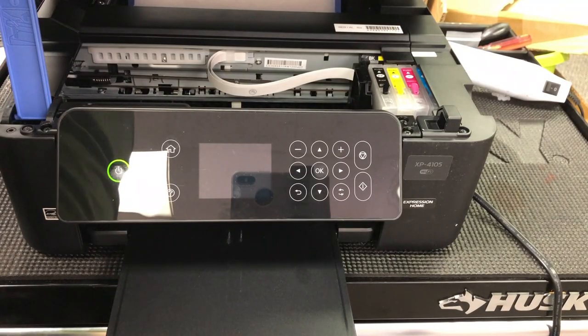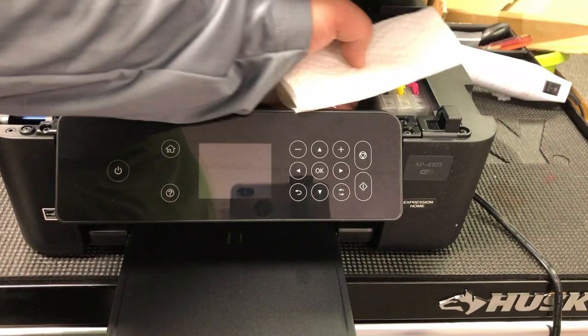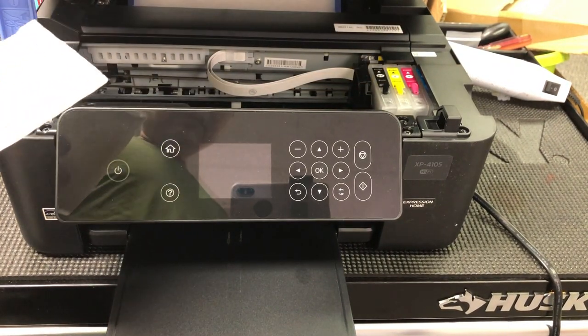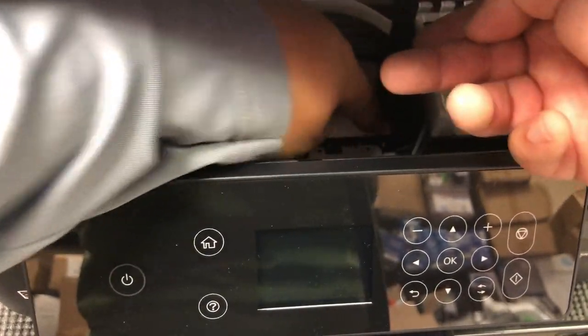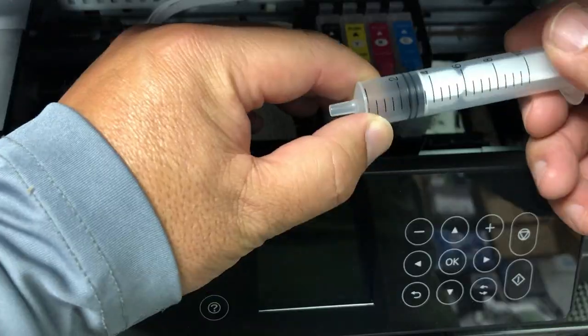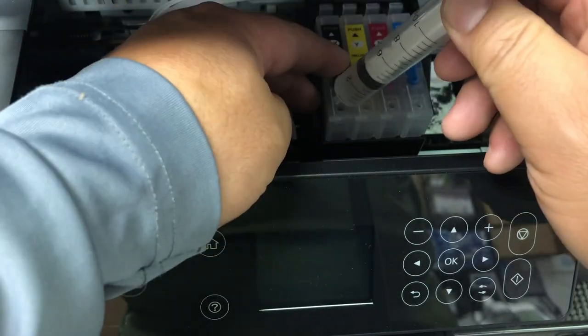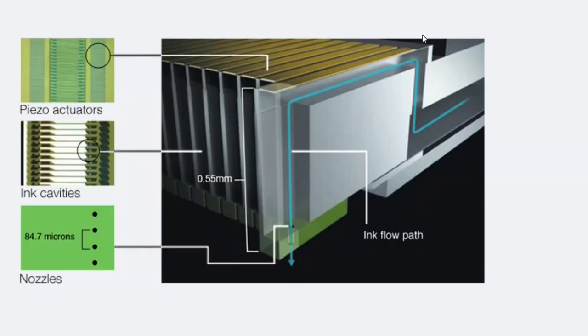Now our last method is to shut the printer down and power it up. Once you see the printer cartridge move, unplug the printer — just pull the plug. In this way, the cartridge can freely move inside the printer. Get a piece of paper towel and push the printhead so that the paper towel is underneath it. Now we're going to blow some air into the cartridge. The maximum you should do is about three milliliters of air. There are two reasons why you shouldn't put too much air — the first reason is you might not have that much ink in the cartridge.